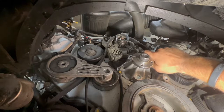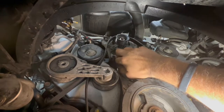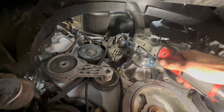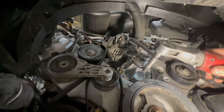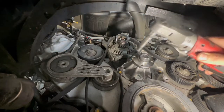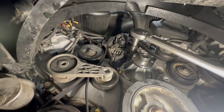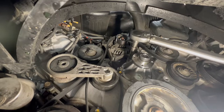You're going to tighten them up in a crisscross pattern. I'll check the book real quick — I'm pretty sure it's 18 foot-pounds, but I want to make sure. All right, we're just running them in, snugging them up. I'm just going until I see contact, going down here to the bottom, going back up here. I wish I could use my little torque wrench, but it only goes up to 200 inch-pounds — it'd be 216 inch-pounds, or 18 foot-pounds.